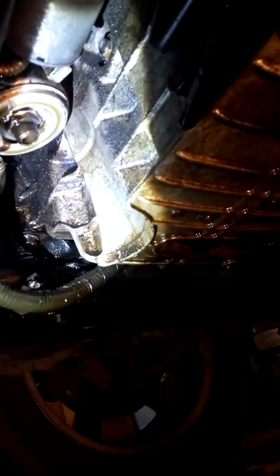Then you get to this point right here. As you can see, let me show you what this looks like — it's really wet all through here, up and under the undercarriage of the vehicle. There's where your oil filter goes — I already pulled it off here, let it run out. Everything's soaking wet. A lot of people get confused by that, but that's because whenever you're driving down the road, the wind and the fans are going and it blows that oil all over the place. Nine times out of ten it's usually that.